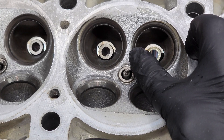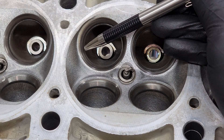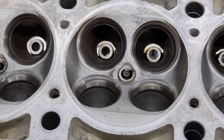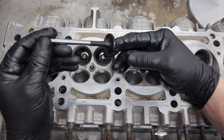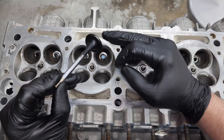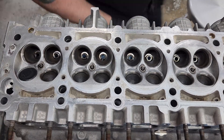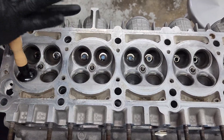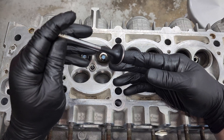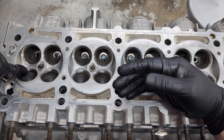You can see right here where there's a clean ring - the cleaned sealing area - and on this one I haven't done yet you can see it's not there. That small sealing surface is cleaning up nicely. Now for the exhaust valves, which should have an even greater difference because these ones are all dark and super dirty, so you're going to see that real clean line, nice and bright. There's that clean bright sealing surface on the exhaust valve - you can see a nice thin clean sealing surface right there.